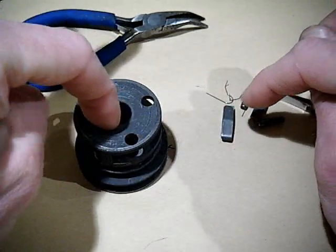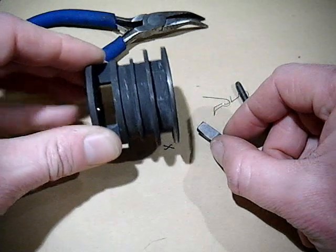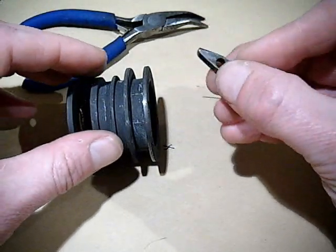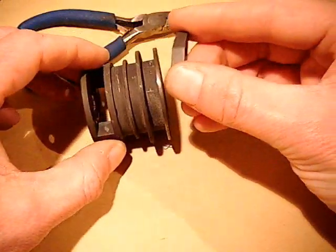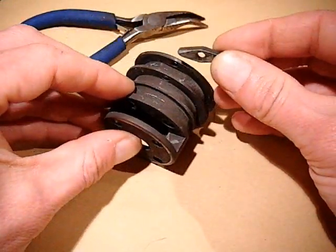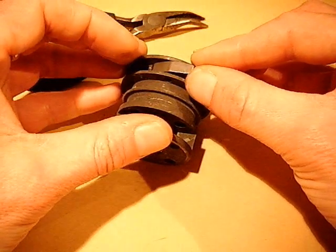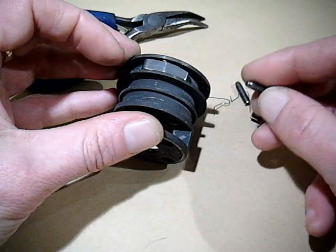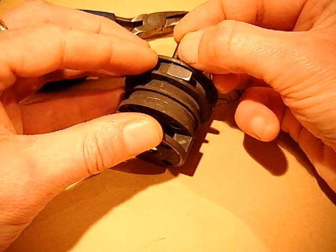Now viewing from the top, the pawls always point in a kind of clockwise direction. My preferred method is to lay it on its side, bottom of it on the right, and lay the pawl on with the flat surface pointing towards you — or face it away from you if you prefer. Put the flat top surface to the right corner, just drop it in the slot, and get one of your pins. These have a rounded end and the rounded end goes in first, coming in from underneath, put the pin in just half way through.